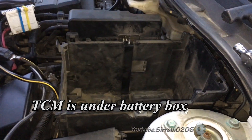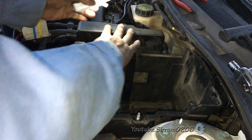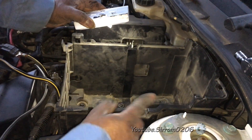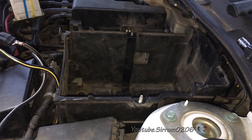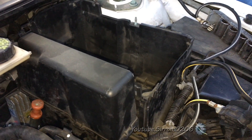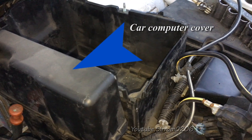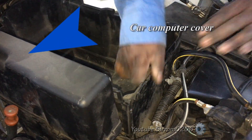There is no airflow in that area. The instructions that came with the refurbished TCM stated we should remount the TCM on the firewall, which makes sense — there is more airflow there. Everyone knows electronics need airflow. Being sandwiched between the battery box and the transmission is a hot spot; failure is going to occur sooner or later.